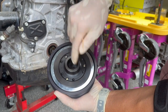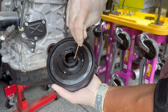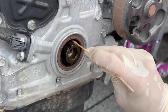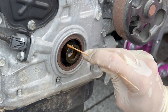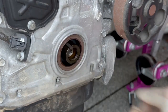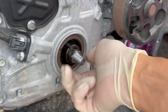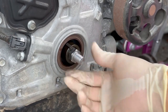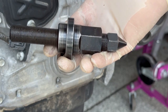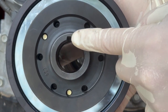I'm going to add a little bit of motor oil to the ID of the ATI Super Damper and along the leading edge, then lubricate the crank snout and its leading edge as well. Followed by installing the key — make sure it's in the correct orientation. Then I'll install the crankshaft adapter; it doesn't have to be installed tight, just snug. Adjust the drive nut so it is closest to the pointy end.